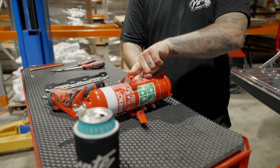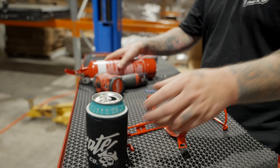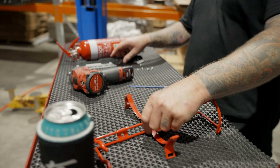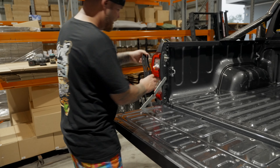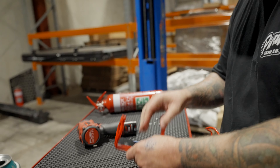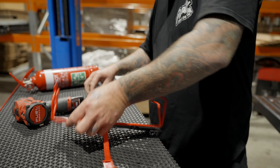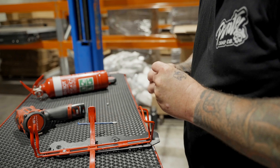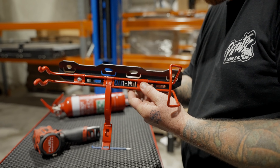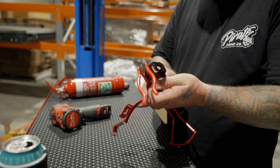So first thing you're going to do: flick that open, peel that out, get that one out - we're all done. Next step - make sure you get it the right way around. So that's our top up here, top of the bracket. We're going to put the bracket on. Get a bolt and washer, drop him in. Get a nut, put a nut on the back. These are nylock nuts as well, so it makes it nice and easy. Then we do that one there as well - bolt him on. Get a four mil Allen key, put him on. Couple of quick turns.